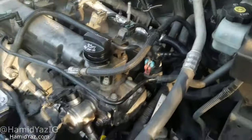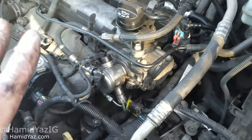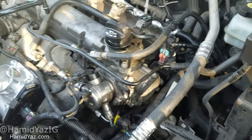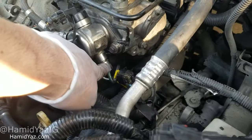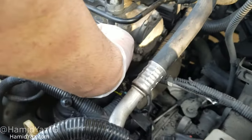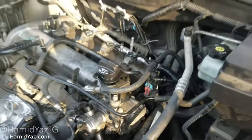The exhaust and intake sensors are the same part — that's the easiest way to remove and locate the two camshaft sensors on a 2011 Chevy Equinox. It's literally right here under there. Best way to get the front one is from here, and then the back one — get it from the other side. It's literally that simple.